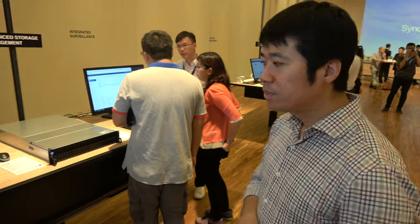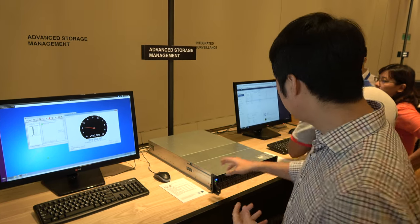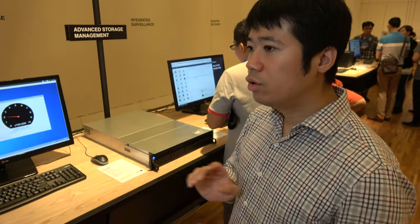We introduced the Virtual Machine Manager earlier this month. It allows you to run Windows, Linux, or a virtual DSM on a single NAS. So you can run a virtual machine on the NAS? Yes, on our Intel-based models with over 4 gigabytes of RAM. They can run Windows. You could do Linux on the ARM ones in theory, but there are performance concerns for the non-Intel ones.